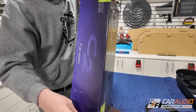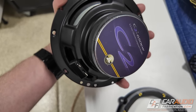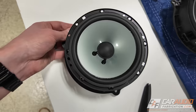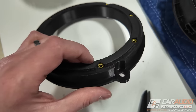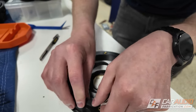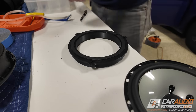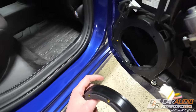You don't have to use 3D printed adapters, but like most things in car audio there are trade-offs with different installation strategies. In case you're new to the project, we're using the JL Audio C2-650 CWS — a component six-and-a-half inch woofer. If I line this up in the correct orientation, you can see through all the holes where the 3D printed heat set inserts are mounted. Those give us threads for the machine fasteners that hold the speaker to the bracket. I've also applied special speaker gasketing foam on here and will apply some to the back side of the adapter as well.